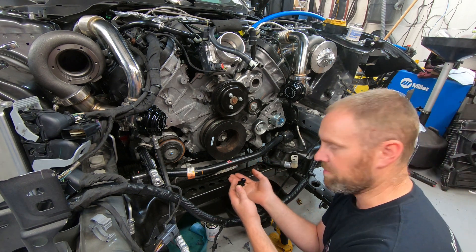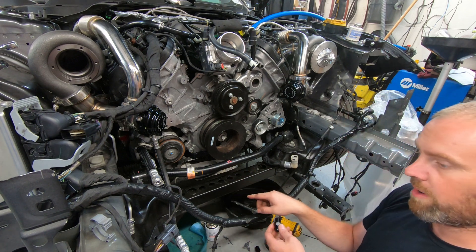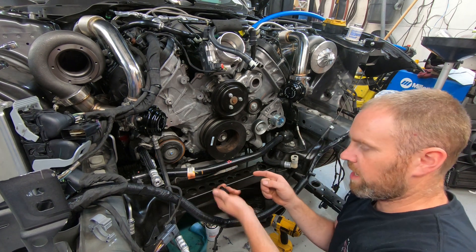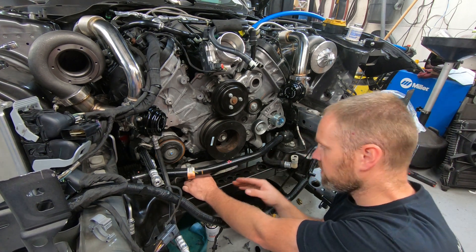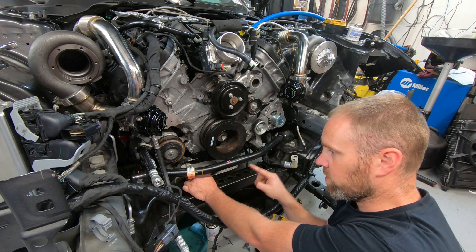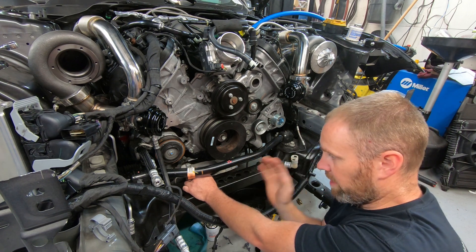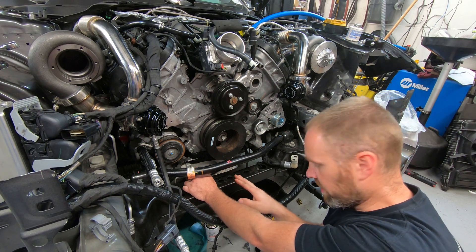I'm going to make sure I keep it under pressure while I throw the tap in there, because of all those shavings. A lot of times with a tap, especially in plastic like this, you can just keep going — especially with a pipe tap — and it'll just make the threads. But because you're trying to keep stuff out of the crankcase, what you want to do is half turn forward, quarter turn back, half turn forward, quarter turn back. It might take a little bit, but by doing that you're creating little bitty pieces that will then be able to fly out. Make sure you don't lube the tap — keep the tap dry — and it'll continue to push things out.